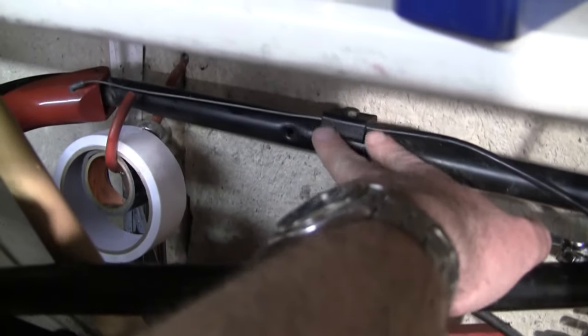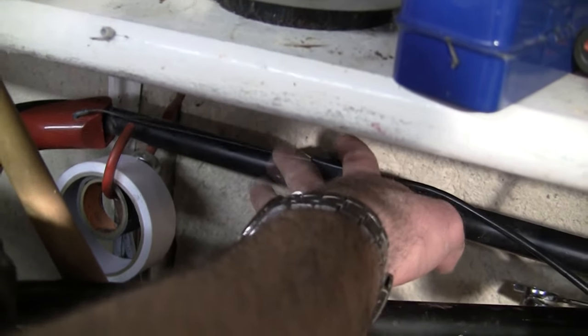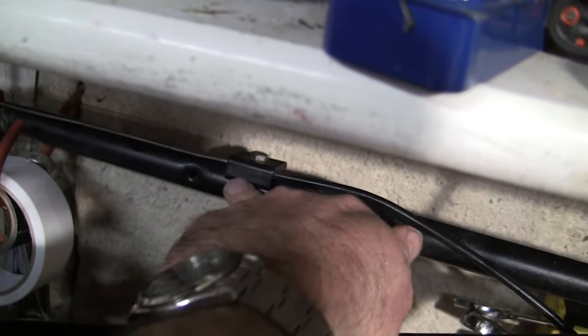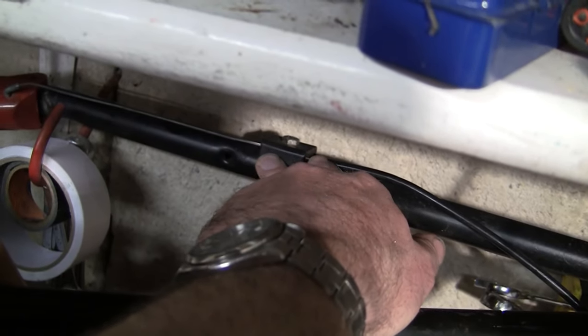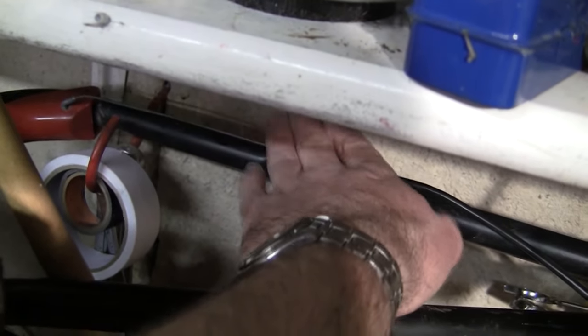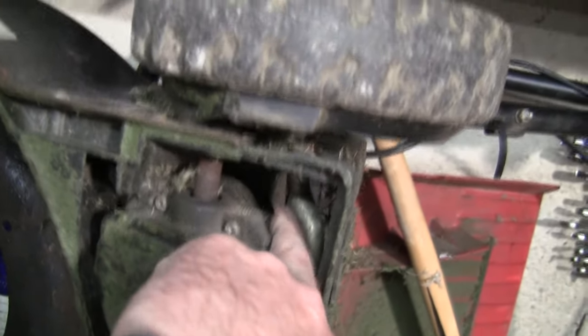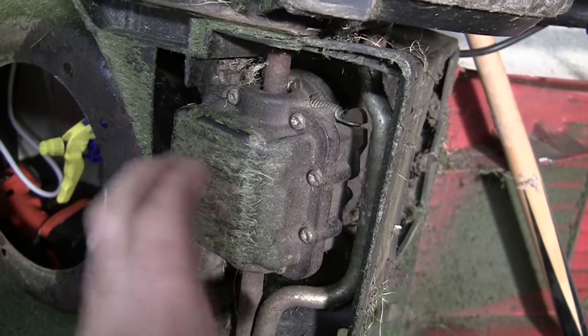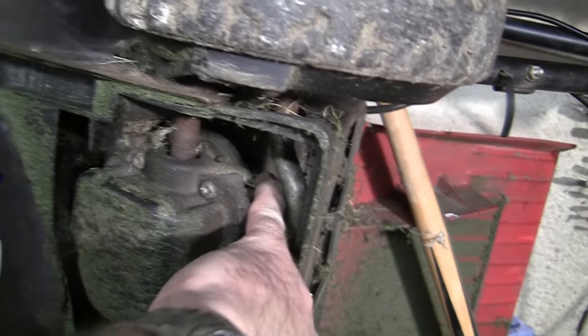The other thing to check on the cable — depending on your lawnmower — make sure the drive cable isn't too slack. If you can adjust it, move it slightly up or down the handle so it's tight enough to pull the cable far enough. If it doesn't pull far enough, it doesn't move that lever across enough and your self-drive won't work. Don't presume the box is gone before you've made sure the levers move across and the cable isn't slack.